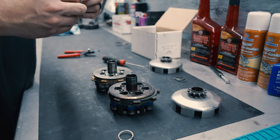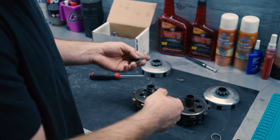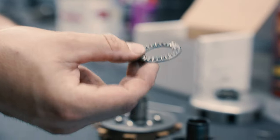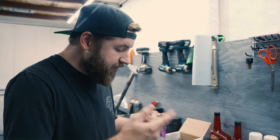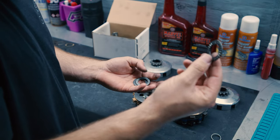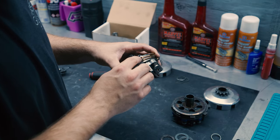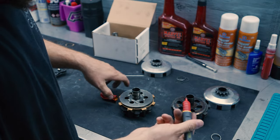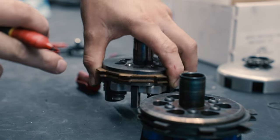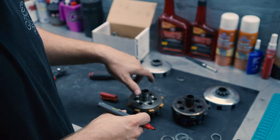All the clutches on this style have a thick washer that goes on first, and that's the most critical part because it keeps it above these bolts. There's different bolts, but these happen to be the same. Most of the clutches will have a little bearing in here. Keep this clean — this has always got to be clean, just like everything else. This is the most critical for that spinning. When you've got it on your go-kart and you spin the tire over, it spins it freely. If this is not super clean, it always causes drag. For basic race day maintenance, I don't ever take this apart. You want to keep the discs matching — they need to stay together. If you were to orientate this differently and it's a couple thousandths out of round, now you've made it even worse.